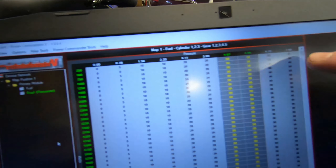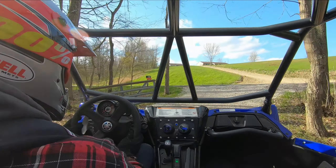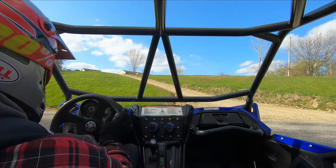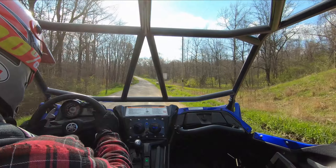With this being a forced induction car, I went with a PC5 boost and fuel unit. You can see that blue labeled sensor there is the MAP/IAT sensor. It references that via a fuel table and allows me to adjust fueling based off of boost pressure. Since this is a pretty simple setup and a pretty simple turbo system, I opted to put the minimal amount of gauges I could in here.